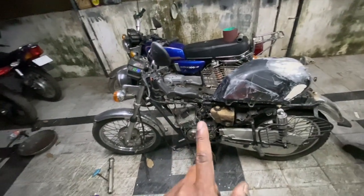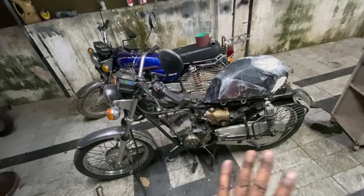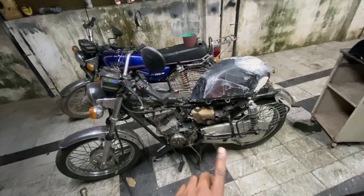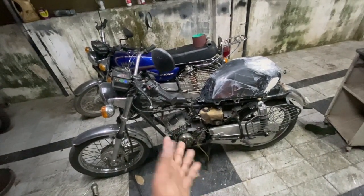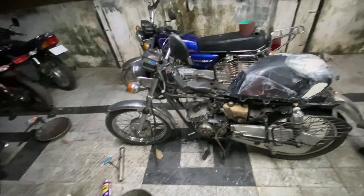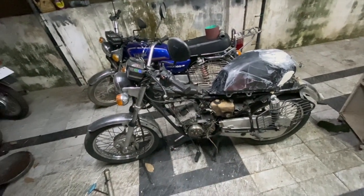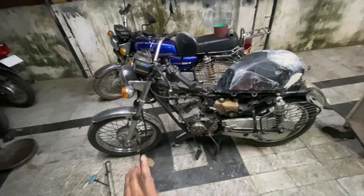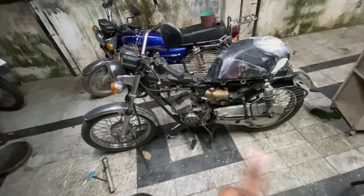About the Tiger — unfortunately I couldn't get the head gasket. The plan on Saturday was to get the head gasket, fix the cylinder and head completely, and then start the bike. So now what we're going to do is put the side covers on both sides, get the head gasket tomorrow or day after. Right now I don't have any shops near my house, worst case we might have to wait till the weekend. Today we will install both side covers, install the carburetor and everything, then put the head temporarily until we get the gasket.